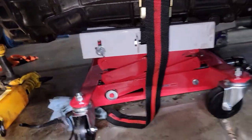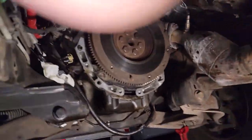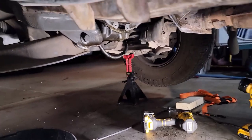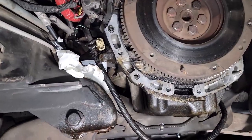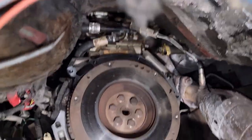This thing was kind of a greasy pig. I did have to go get a transmission jack because I didn't want this odd-shaped thing falling on my head. Didn't take too long — just a couple hours after work. Got the truck all up on four jack stands. The back wheels are actually on the ground; I just lifted the suspension a little bit to level it out. Most of these are 13 millimeter bolts that go around the transmission, and it's out.